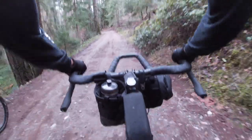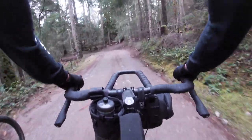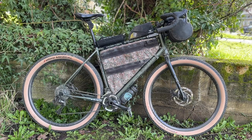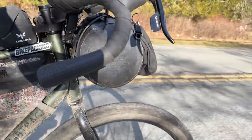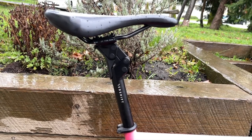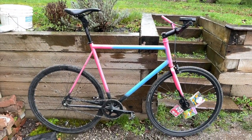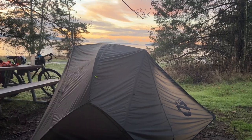For the kind of bikepacking I do, I don't really see myself using the suspension seat post on an ongoing basis, as there are only marginal gains in comfort. That said, your experience may vary — it could benefit you if you have back issues, fatigue easily on gravel roads, or have narrower tires. I ride 2.25-inch mountain bike tires with a tubeless setup, which provides a good level of suspension on its own. I have found a good use for the ShockStop seat post on my fixed-gear commuter with 27 millimeter tires, where the narrower tires and constant pedaling make it really helpful for smoothing out the road.